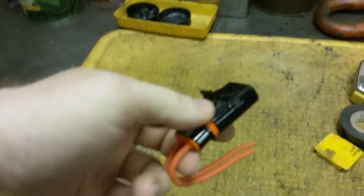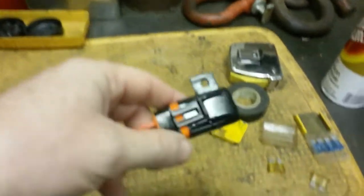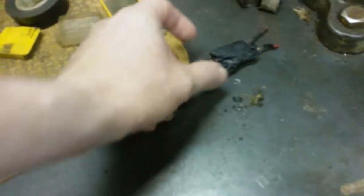We went down to NAPA this morning and got a new fuse holder — right over here is what we got. It's got a cover on it, and we think that's what the problem was: the original fuse holder actually got some dirt up in it, possibly causing poor contact. Here's what's left of that 20-amp fuse right there — it just melted. When she drove the lawnmower from her shed up to her house, that's when it really got hot and was smoking. We test drove it a little bit yesterday evening and everything seemed okay.